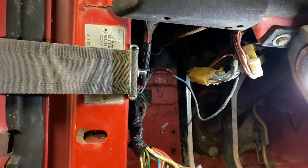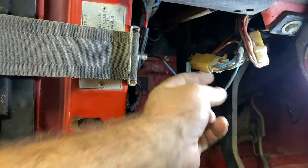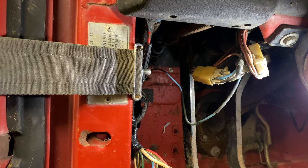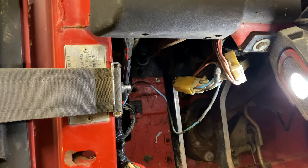I'm going to tuck this wire up and away. I also fixed some of the wires in here that were literally soldered and electrical-taped around. I've got more in this vehicle that I will find - I know there's some just butt-crimped ones that are not okay with me, and those will get changed yet too. Let's turn the key to the on position and see if we get the pump sound going.